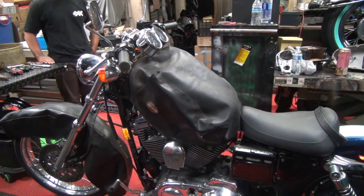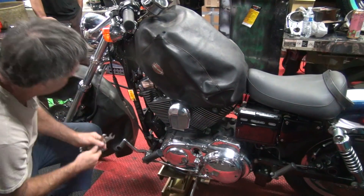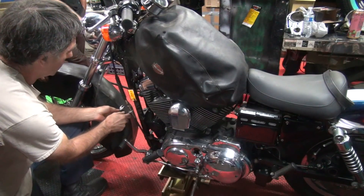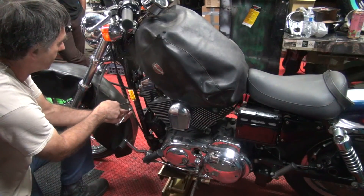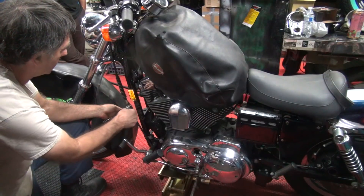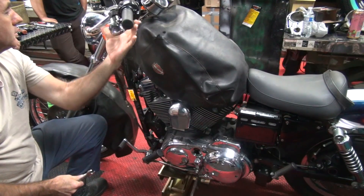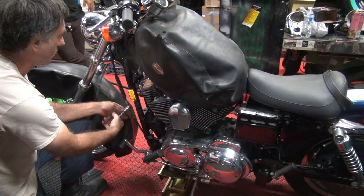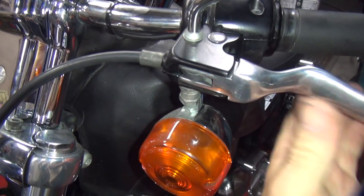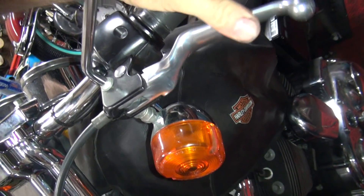We just pull out the cover right there and look inside to see if it looks like old oil or new oil. I'm pretty sure I didn't change all this — the motor I'm not sure about. I'll check the primary chain tension in here and see how it looks. It appears to have old oil in it down there — it's kind of black, especially when the light goes off. Anyway it's kind of dark and dirty looking.